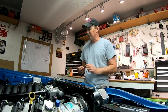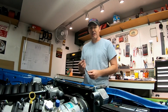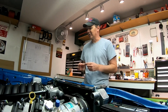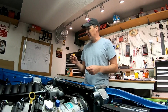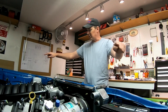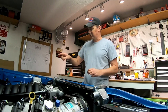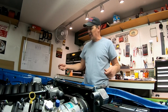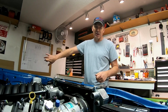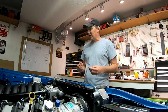So one of the things that I've been using a lot on this build, and I've used them before in the past and they work very, very well, Mag Daddy zip tie mounts. Steel body truck, I can stick this thing anywhere I want to and attach a wire and hold it. Matter of fact, in the sides of the fenders where electrical comes into the front, everything's loomed, and once I get it done, I stick a magnet up in there with a zip tie on it and hold that up so the wire isn't rubbing on anything going down the road. It's up, out of sight, out of the way, and it's held there. They're 10-pound magnets, and they will hold.